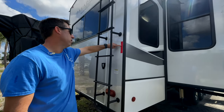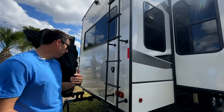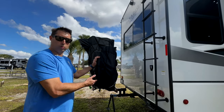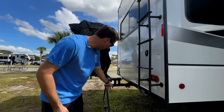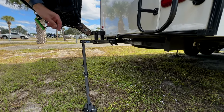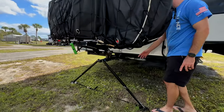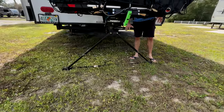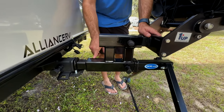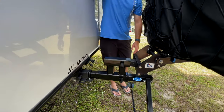We added a bit of reflective tape for visibility since we travel with two bikes on a 1UP rack — not sponsored, just works really well. We have the Moride stabilizer in the back, set up on a double receiver hitch so the bikes go on top and the stabilizer below. We also put in a small bracket to keep the hitch from bouncing when we travel, keeping everything tight in the receiver. And there's the LED light strip just plugged into the four-flat towable plug.